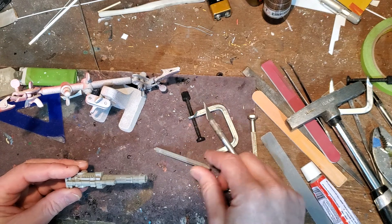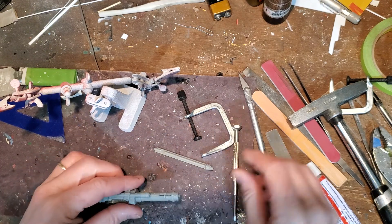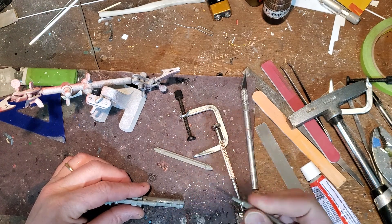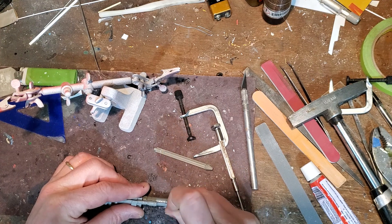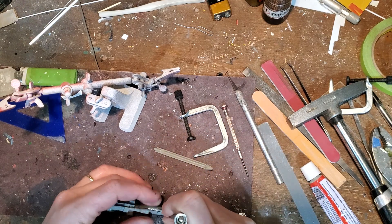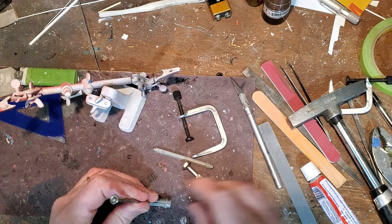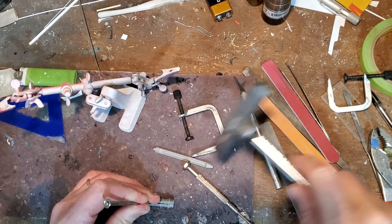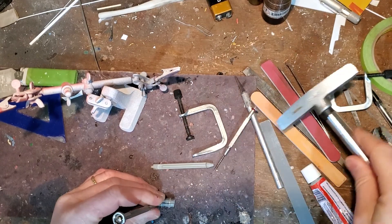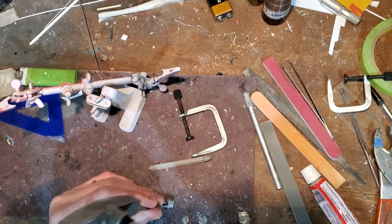What I ended up doing with the other one is taking it apart — these are just two halves that are lightly glued together. This one is a bit more of a bugger than the other one was. What you need is a flat screwdriver, and the thinner the better so you don't notch into the plastic. But wider and flat is also good. I want to spread these two pieces apart using a screwdriver and a hammer. You'll see it start to come apart — there are some little pins on it, and hopefully I don't break them off.